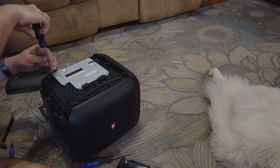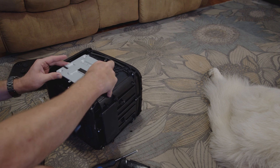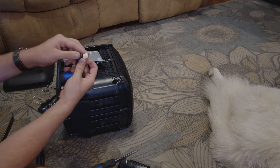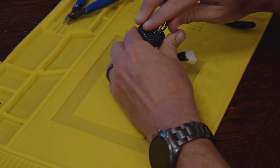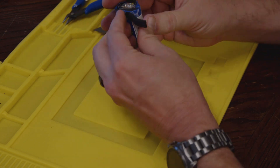Under this metal piece are the electronics and battery pack — these are just Phillips head screws again. Do not try to lift the panel all the way off, as there are multiple wire connections. Just lift it up a little and disconnect the battery harness and pull the battery pack out. I'm just removing the shrink wrap, and I put a little too much effort into trying to save the foam parts.